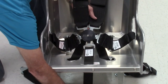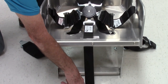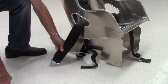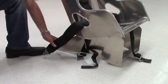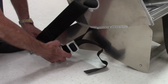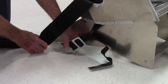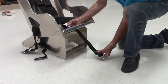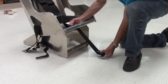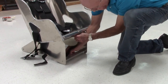Note that all crotch straps for 5, 6, or 7-point systems need to be fit using the 3-bar adjuster during installation. They cannot be adjusted once you are strapping in for a race. Lap belts and crotch straps on a 6-point system are mounted outside the sides of the seat at approximately a 45-degree angle to the seat as shown. They can attach to the same point or at separate points. On a 7-point system, the 7th strap mounts to a point forward of the seat in line with the angle of the shoulder straps. With a 5-point system, the crotch strap mounts back under the seat as shown.